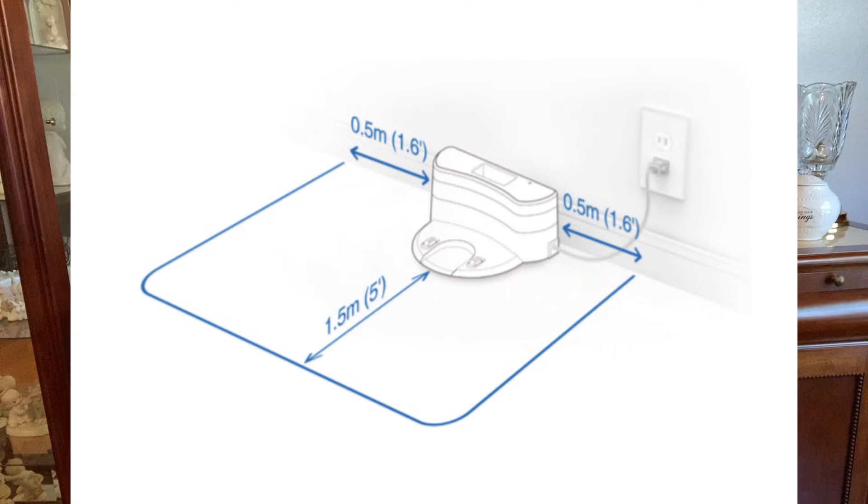The newer T9 screens may differ and some older models won't have all these features. First off, you'll want to find a good location for your charging dock or auto empty dustbin. Per vacuum instructions, place the charging dock on a lower floor surface against the wall with the base perpendicular to the ground. Keep the immediate area 1.5 meters or 5 feet in front of the charger and 0.5 meters or 1.6 feet on both sides of the charger clear of objects and reflective surfaces. If you're planning on using the mopping feature, you will definitely not want the dock on the carpet.